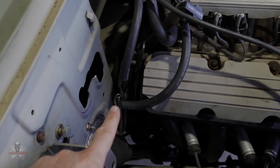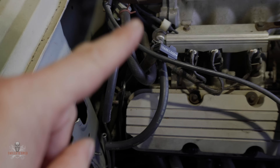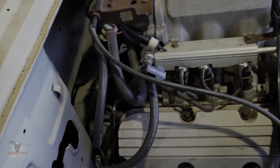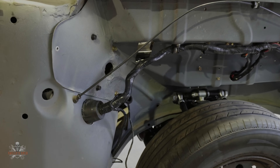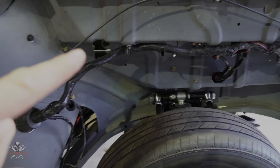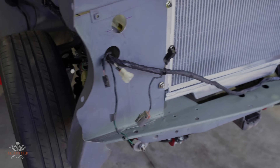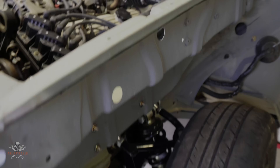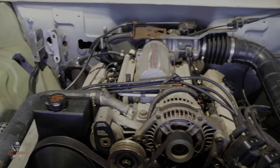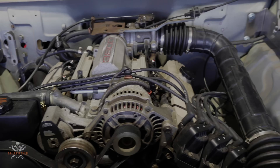It's literally just finishing off the fuel line. I've got to pull these fuel lines out, put a proper end on those so I can run new hoses to the fuel rail and to the manifold. And I've got all the wiring running up underneath the guard there, so that'll all be basically hidden — which means the engine bay can be fairly clean and not really show any wires.